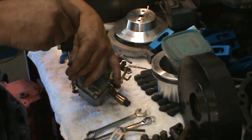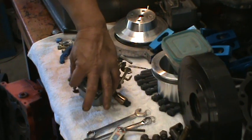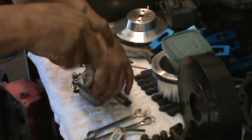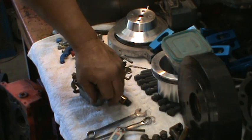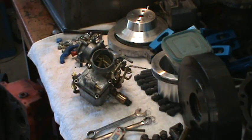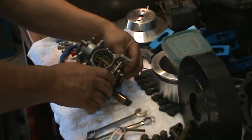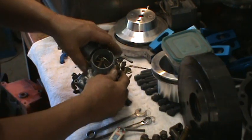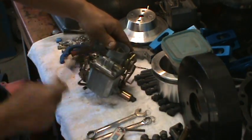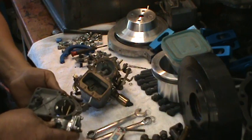I want to do this first because a lot of guys aren't going to go to Kadrons — you're going to have this carburetor and have this issue. I've gotten several emails about guys who have encountered this problem, and more guys are going to go out and buy the stock carburetor than get Kadrons. A lot of times it's because they don't want the trouble of dual carbs. But you still get this headache. I always say go with the dual carbs even though you have to re-jet them — that's why they don't run good right out of the box. You're either going to have to re-jet the carburetor or have somebody tune it for you.